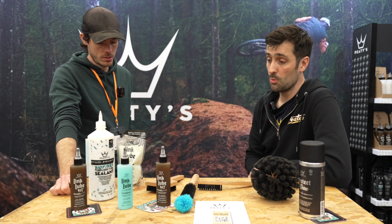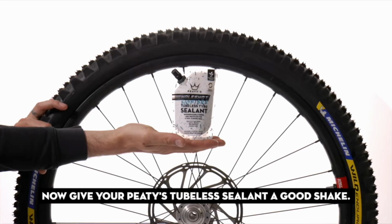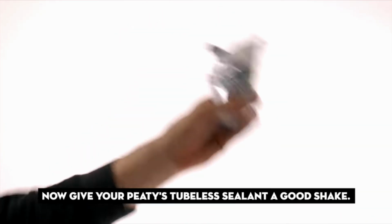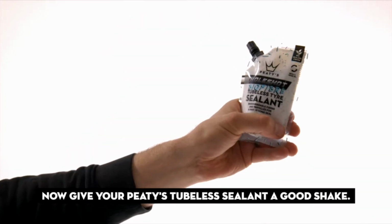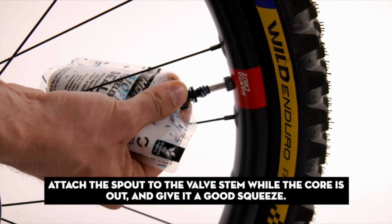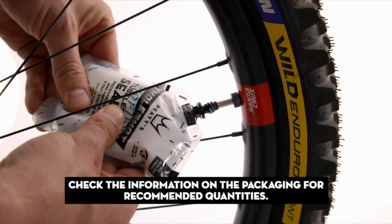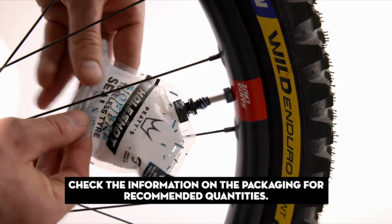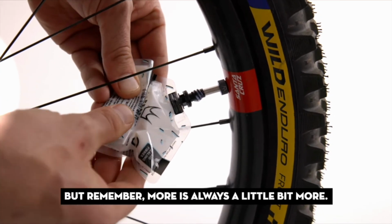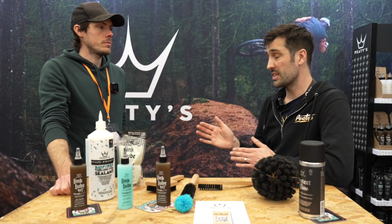It's a water-based latex formulation, so it's a bit of a balance because if you use a natural latex, you have to suspend a natural latex in chemicals. You can use a synthetic latex, which sounds bad ecologically, but actually you can then suspend that in water. So there's a big balance to make in terms of longevity in the tyre.